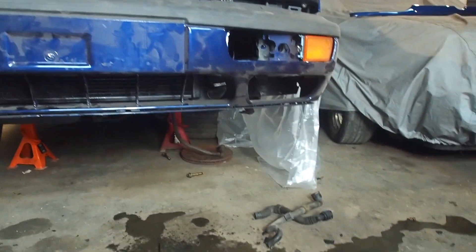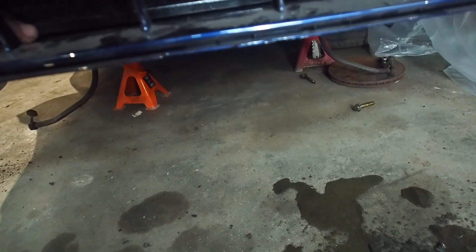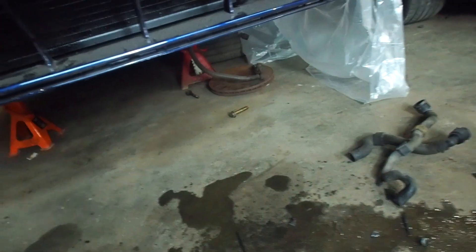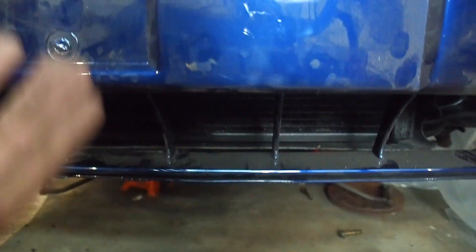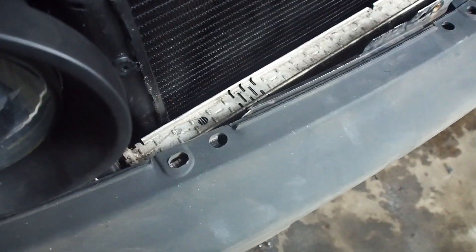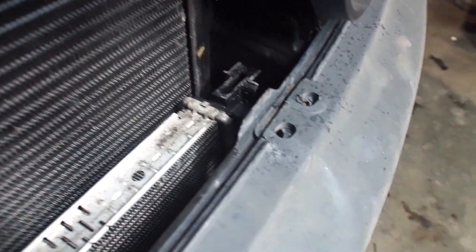You can't see anything from outside, so that's perfect. I've cut this bit out here which stopped some air, so the air is going to go around there instead. I'll probably put a bit of plastic back in there to trap all the air so it can't escape, and put partitions up on both sides so all the air gets fed in through there and forces up through the rad. It fits perfectly in there - I'll just screw it into place with some little L-brackets and then do the coolant pipes.